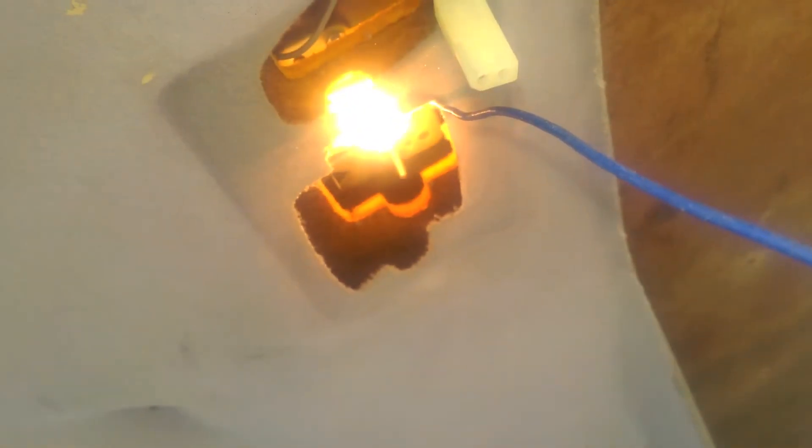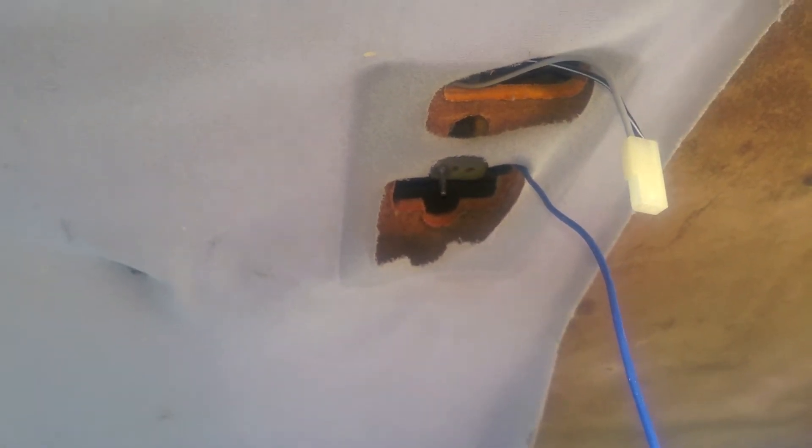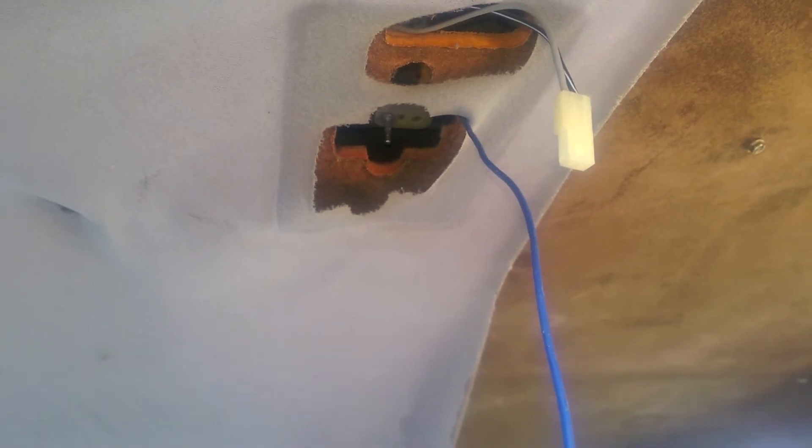That gray wire runs into this harness and then goes to the switch. If I take my new blue jumper wire and touch it to the gray contact here — look at that, the light works! So that tests the entire system. What we're doing is giving it a ground source — that ground source is where the switch would normally ground. I'm basically just jumping over the gray wire connection.